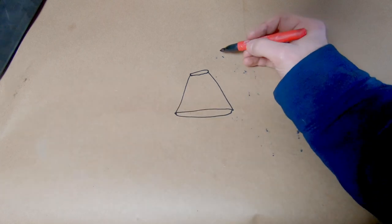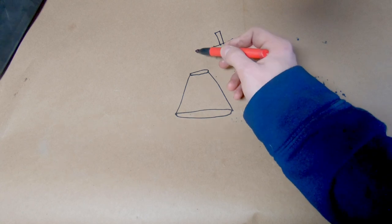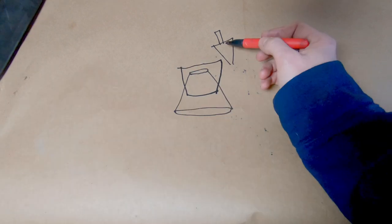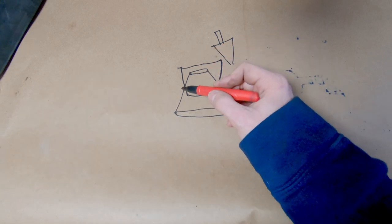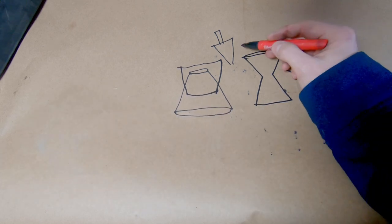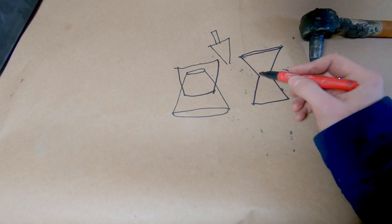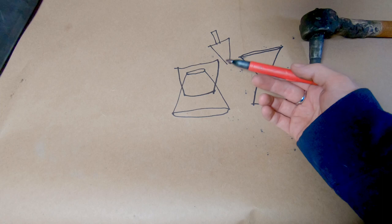So how do you keep your taper? One thing you can do is take a tapered reamer and ream out the top so that the taper on the top matches the taper on the bottom. The only issue is that once you ream the top of your steering knuckle, what you end up with is not a perfectly tapered hole — you end up with an hourglass-shaped hole. This hourglass shape will work fine at first, but it gives you way less material holding onto the taper, and eventually it will probably wallow out too.